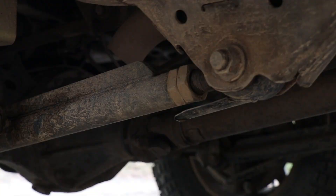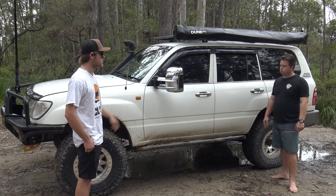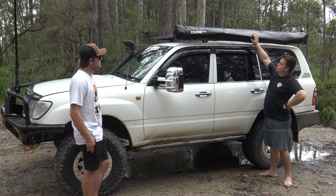What control arms are in the back? I have the adjustable Dobinsons rear trailing arms - only lowers, still standard uppers. Then obviously the sway bar extensions in the back to make the sway bar happy - that's pretty much all that's going on with the back suspension. Same as the front with shocks and springs but just strengthened lower trailing arms. You'll be right with the uppers not being strengthened because you're not going to hit the uppers. What rock sliders are these? They're a custom set made by Pro Tube Works, a guy based out in Woodford. I went for the kicker style because this is going to be put on some gnarly angles.